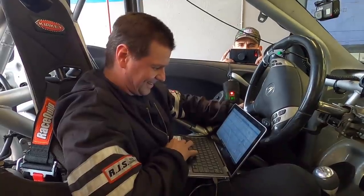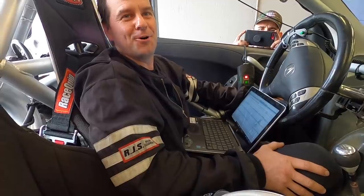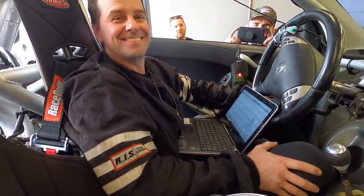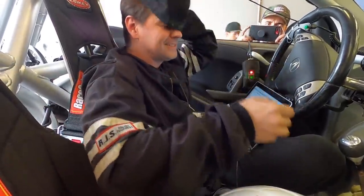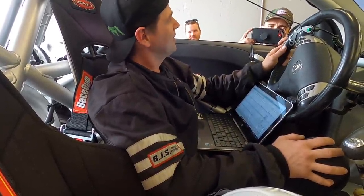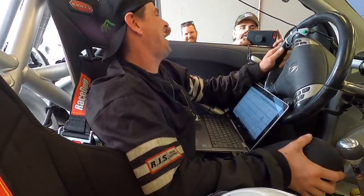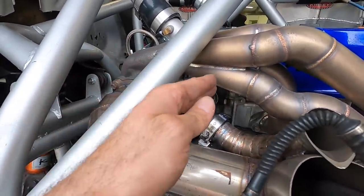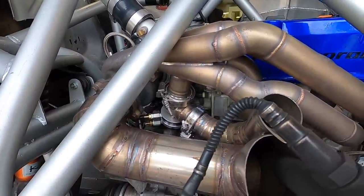The lightest spring. So we definitely have some sort of exhaust problem. We got a flow problem. We're not able to evacuate and we're running the compressor speed too high. So that's it. We can relocate the gate, or a second gate, or just let it rip. Let's keep tuning, man. So unfortunately, although this is absolutely gorgeous, we might have to alter that guy right there, or make it bigger, I don't know yet.